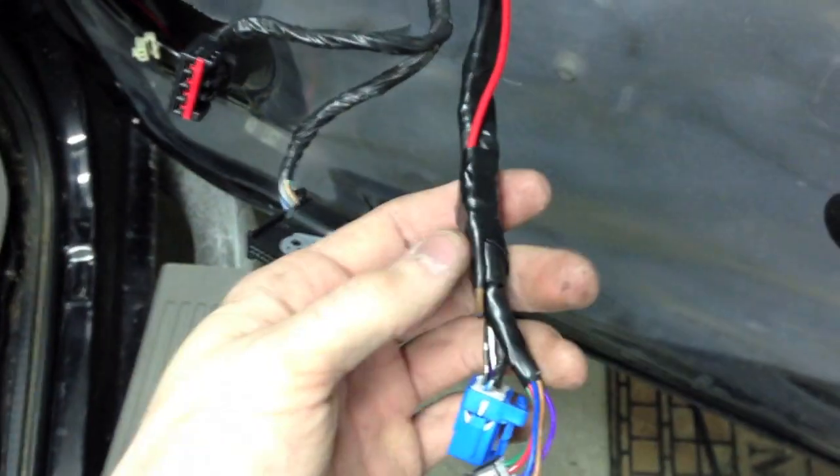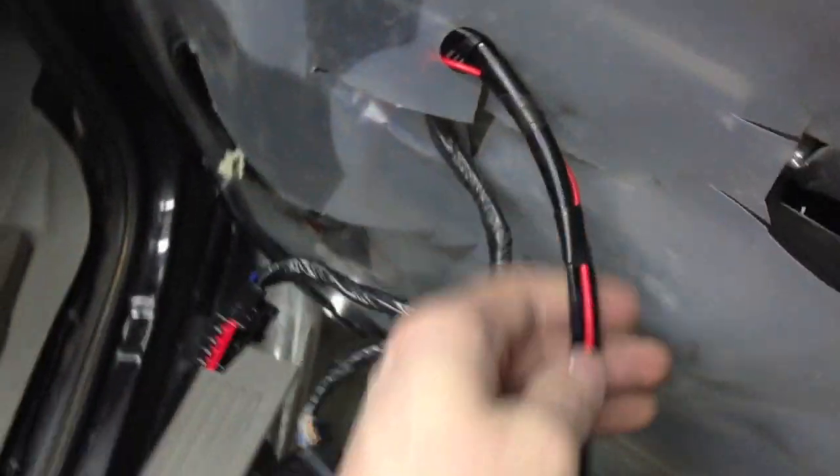I just finished this one because I already explained this on that side. I ran into a little problem over here, so I'm going to explain how to get around it. Same thing — run the red wire down through there, up through the grommet. On this side, to get it through, there's a little hole right here where this green wire comes through. But to get to it you need to pop the trim pieces off — this has to come off. After you get that one off and out of the way, this one comes off the wall. Then you can pull it through, solder it in, and it's done.